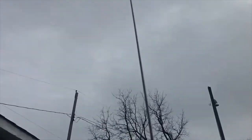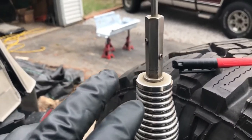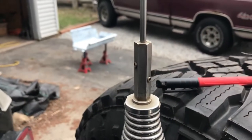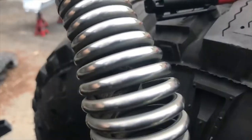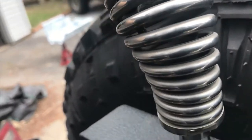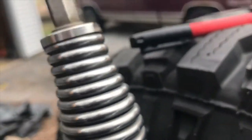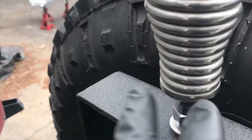Got it drilled out and mounted — a nice tall classic whip-style antenna. When we get to mounting the CB and tuning everything in, these screws are what you use to adjust the length slightly for fine tuning. Inside the springs there's a cable that carries your signal — you always want to make sure that's still intact and in decent shape, which it looks like it is.